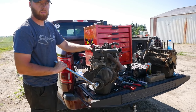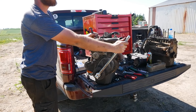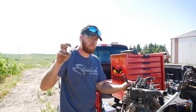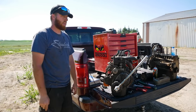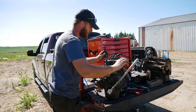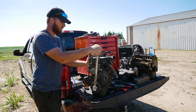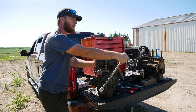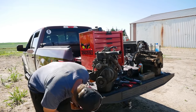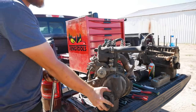Right now our exhaust valve is down. That means we're starting our exhaust stroke. There is the top dead center of that stroke. The mark still lines up with the tabs, but we're actually 180 degrees off, which is what this is called. So if you set all your timing and it won't fire and it's popping out the carb or blowing out the exhaust, see if your distributor is 180 degrees off. Verify that you're back on that compression stroke and you are truly at top dead center.